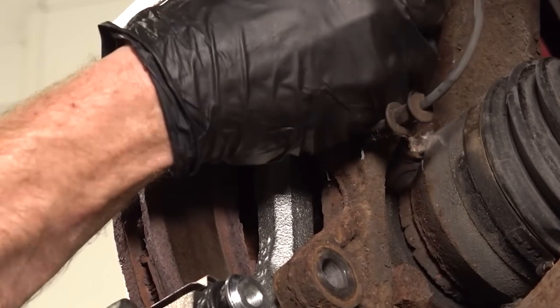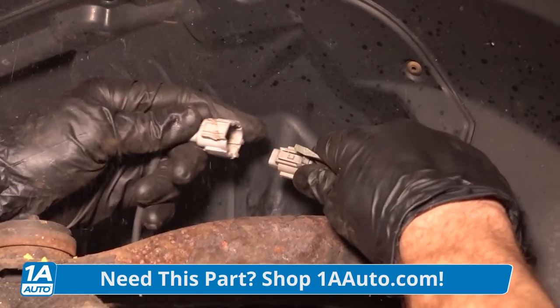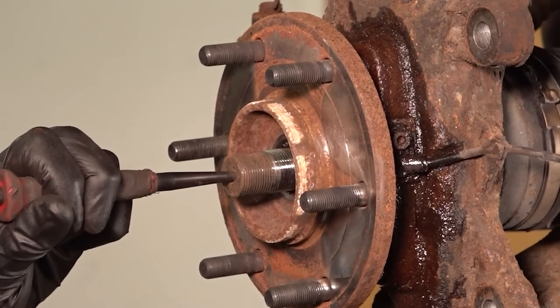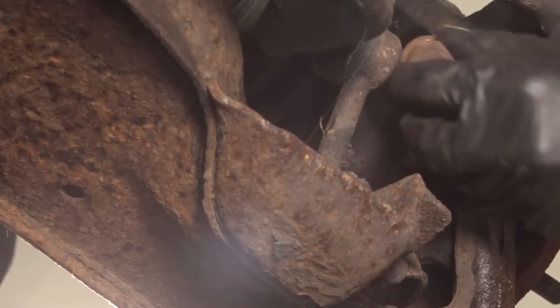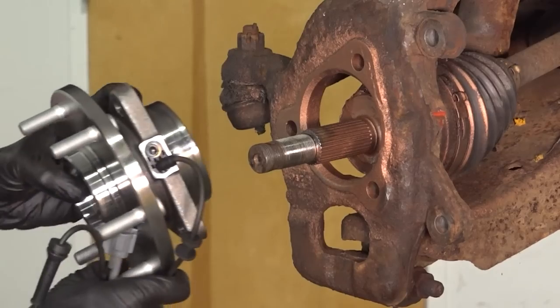It's time to talk about fixes. It really depends on what type of wheel bearing you have. If you have a press-in wheel bearing, it's going to be a little bit more difficult. But if you have a bolt-on, generally they're fairly easy. What you'd want to do is safely raise and support the vehicle, remove the wheel, remove and inspect your brakes — make sure there's no damage and they're not worn unevenly. Of course, if you do need brakes, get them from 1aauto.com. Once you have the brakes out of the way, you should be able to clearly see the wheel bearing. If it has an ABS wire, go ahead and disconnect that. After that, dismount the wheel bearing from your steering knuckle — take off the axle nut first, break the axle free from the wheel bearing, and then from the backside there are generally three or four mounting bolts. Once you remove those, give it a couple of loving taps and remove it from the steering knuckle. Compare it to your brand new one and, assuming it looks the same, make sure you clean all of your mounting hardware and reinstall it per manufacturer's specifications.